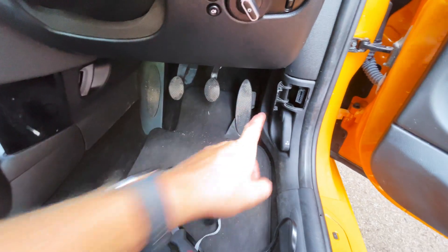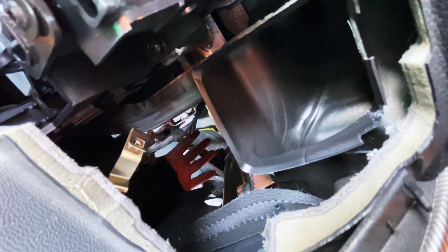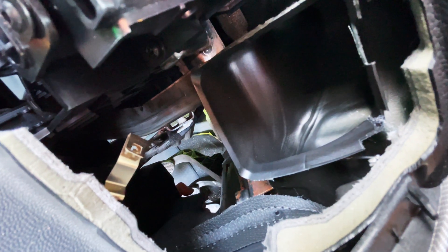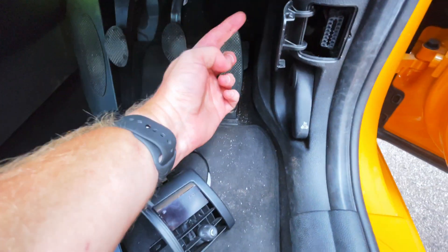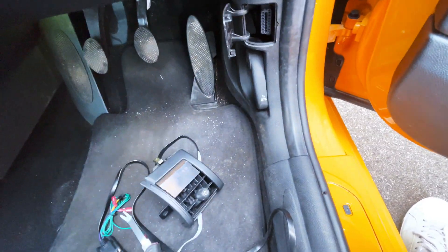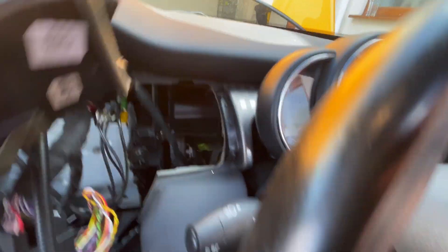I'll show you just how easy it is to get the wiring down here. If we look, there are the pedals — if we come up and look down in the dash, you can see my fingers wiggling down there just above the pedals. All we've got to do is pass the cable down there, go under the steering column, out through here, tuck down because there's a little ridge up there you can tuck into the back. Super simple to run the cables.